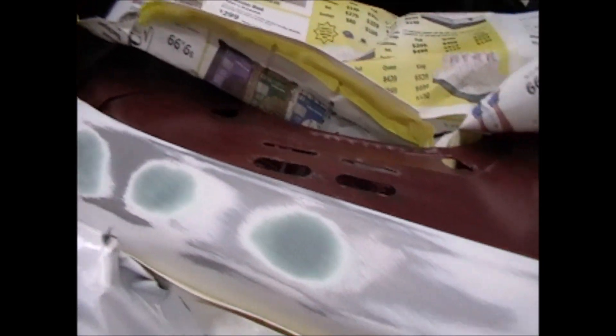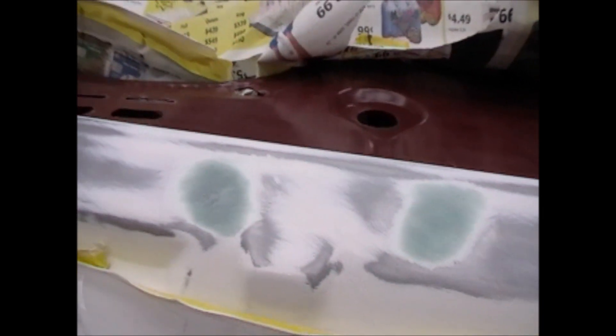This is my first attempt here. What I plan to do is put a couple coats of epoxy — this is all in 80 grit — and I'll put two more coats of epoxy on it once I finish this other side, and then come back with some 180 and block it out. It's probably way overkill for what I'm doing because this is a panel that nobody's going to see — the rear window is going to lay right on this area — but I'd like to learn the skill right here, and then when I get to an outside panel where it matters, I'll know more about what I'm doing.